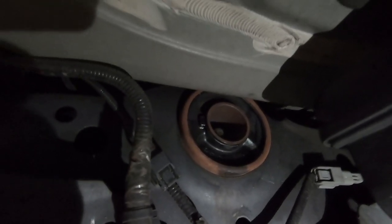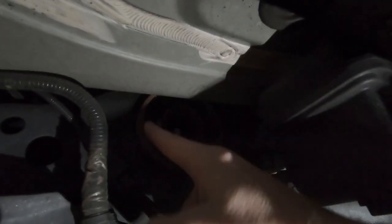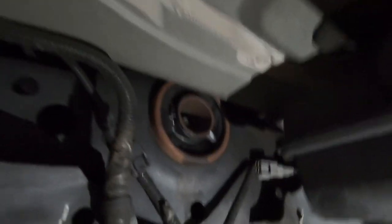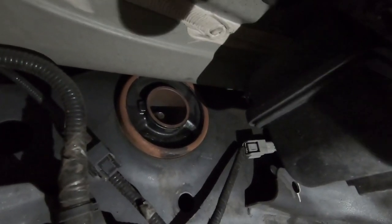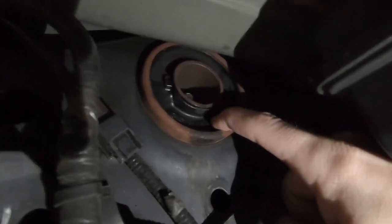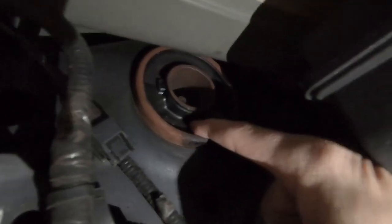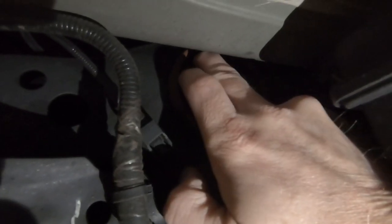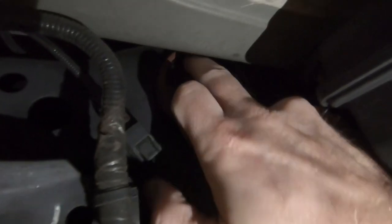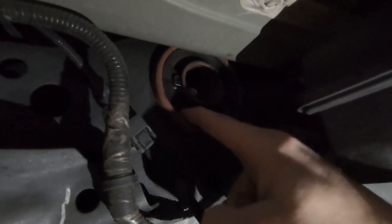If you look up here you can see the residue on the bushing itself — it definitely looks wet and greasy, like there's a hole in it on the bottom side. You can actually see a little bit of the residue right here. When I push on it I can hear it on the other side like there's a hole — it's like a gooey noise. You can push up top and it's almost like it's totally empty there; it's just soft rubber. It's definitely leaked all the stuff out.